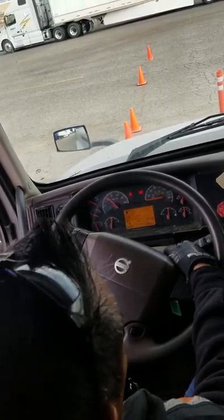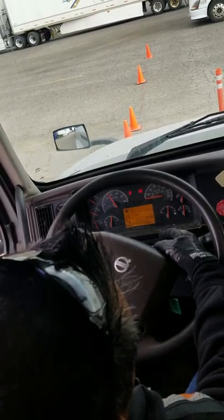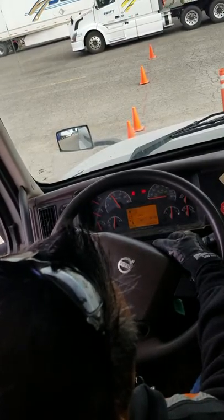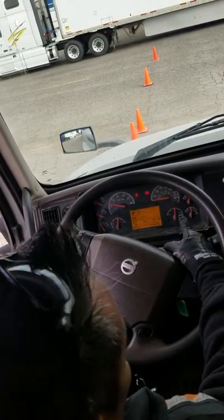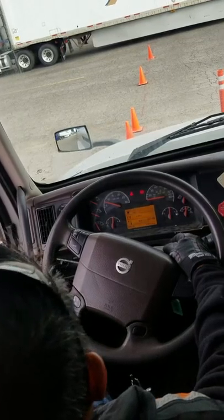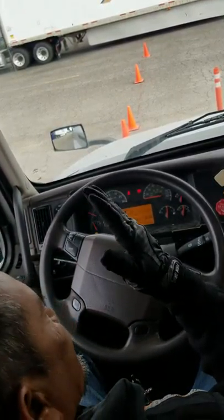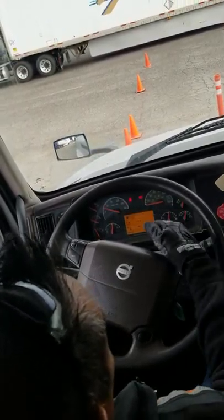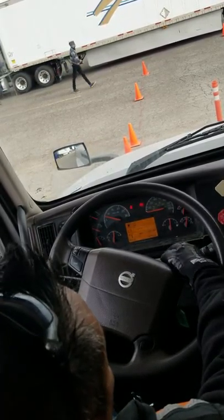I'm going to throttle 10 seconds. 1, 2, 3, 4, 5, 6, 7. All right, I do have cut in. Where did I cut in at? 105. Okay. Wherever it's settled, that's where it's going to begin to rise. So I have a good test. My compressor cut in at 105 PSI. Therefore, it's good because it never fell below that 100 mark.